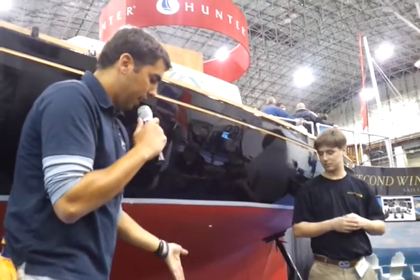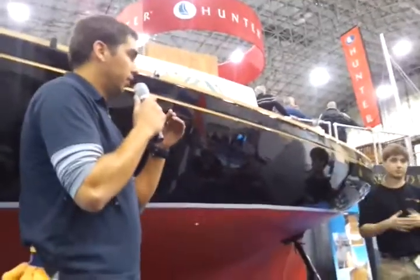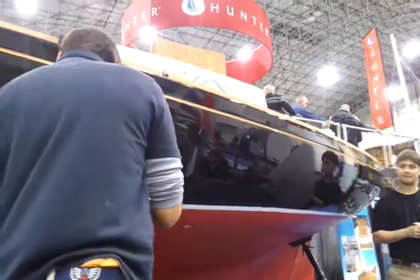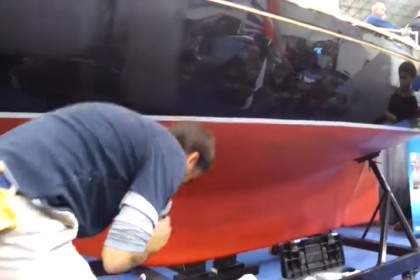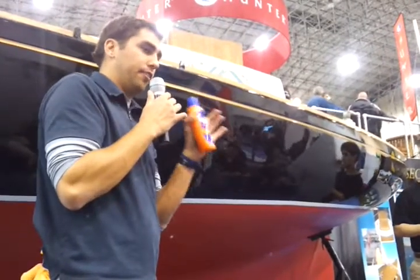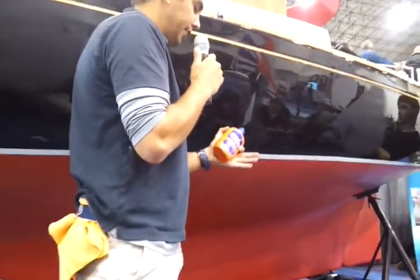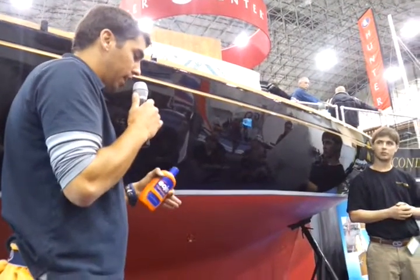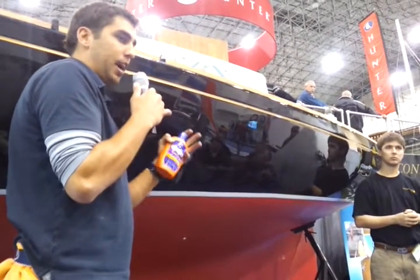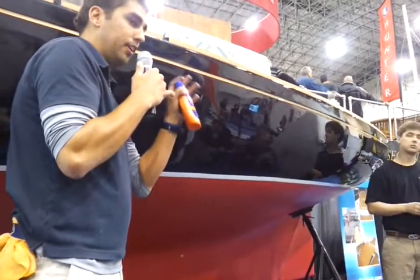Yep. These products, these compounds, are a liquid paste with a little bit of grit to it. It's an abrasive. And there are other products, soft scrub and bleach or Scotch-Brite, the liquid cleaners. Those are gritty products. I don't think I have any with me here. But another thing we use, let's say this is the same thing, we're using the grit to go after something. Let's say if you have paint on your hands and you're a mechanic, you use this stuff to get your hands clean. It's gritty. If you have vinyl or leather seats, we'll put this on the seats with a little bit of Simple Green, a little bit of degreaser, and then we work that with a rag or a soft brush, and it's going to get in the creases in your vinyl, the creases in your leather, and we're using that compound to agitate and to get the things out. The abrasives are great. Obviously, with leather or vinyl, we're going to use something a little bit softer.